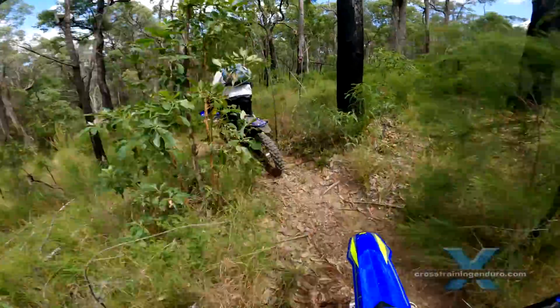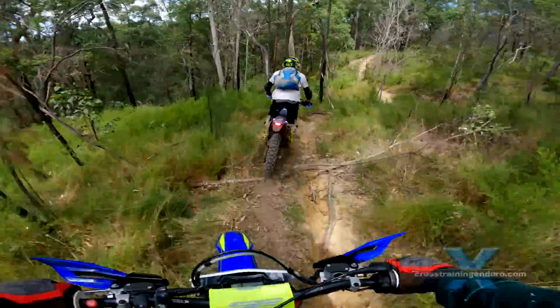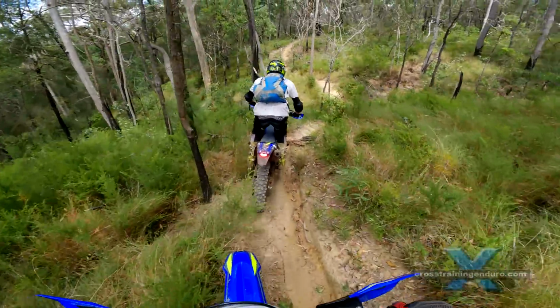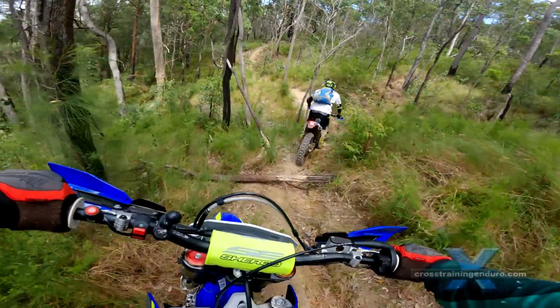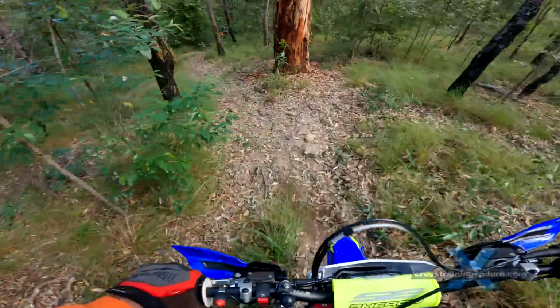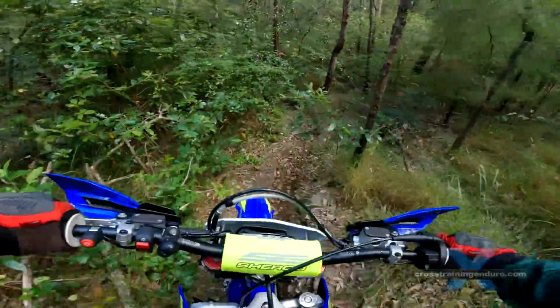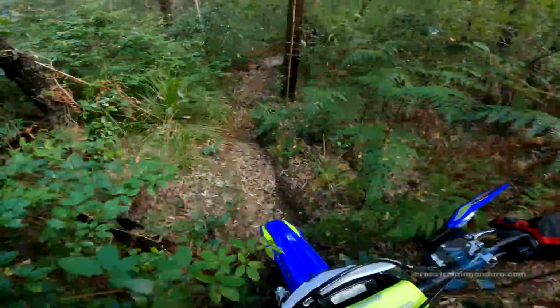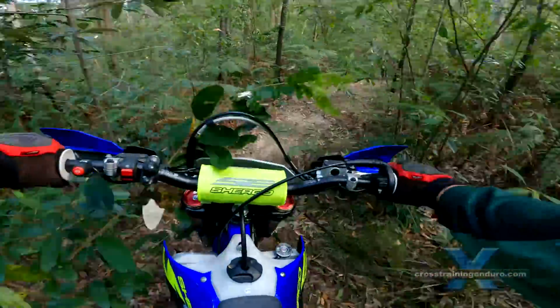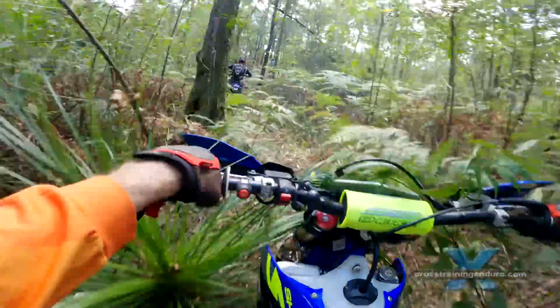The KYB suspension on the factory edition is superb the harder you ride. However, the forks do feel a bit harsh for slower technical terrain. My dealer suggested reducing the compression damping to only 3 clicks. This helped a lot, but eventually I reduced it to 0 and it's just about perfect now for our style of riding.